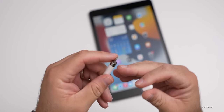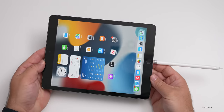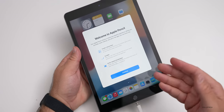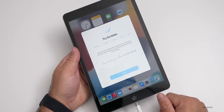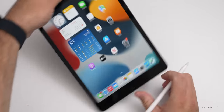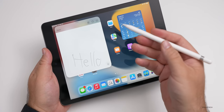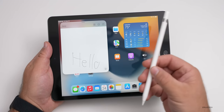This iPad is compatible with the first generation Apple Pencil — not the second generation — which means you use the Lightning-based first gen. You can pair it by plugging it into the bottom Lightning port. After a moment it shows a Bluetooth pairing request; hit Pair and it connects. It mentions the Apple Pencil battery is low, but after hitting Continue it shows how to use Scribble. Once unplugged, you can use features like Quick Note by dragging in from the corner — writing works perfectly.